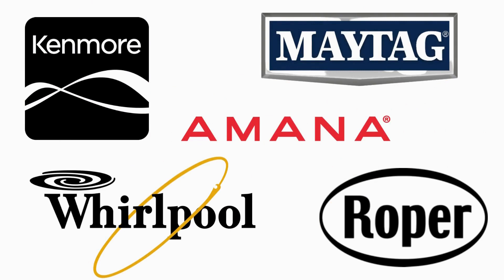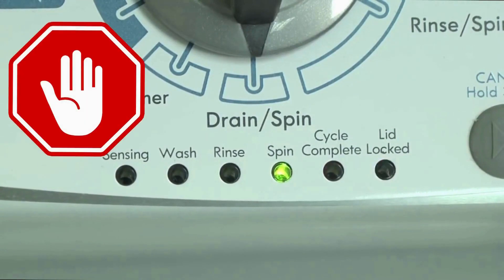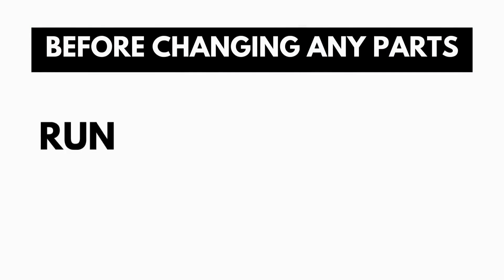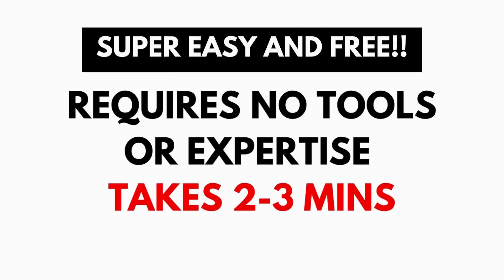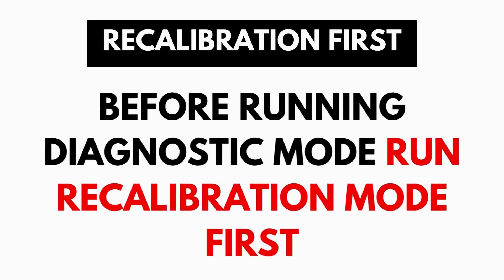The best way to recognize these washers is by the lights on the panel. These washers have a built-in self-diagnosing system that can tell you exactly what's wrong with the machine. It should be noted that when the washer runs into an issue, it stops itself and blinks the lid lock light at you, waiting for you to run the diagnostic mode. A blinking lid lock does not necessarily mean you have a bad lid lock. Entering and running the self-diagnosis is simple and requires no tools or previous experience.